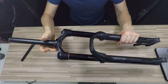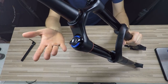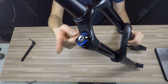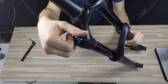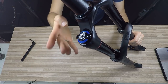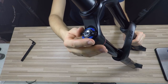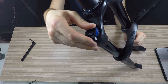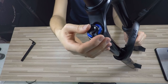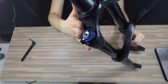Finally, the thing I don't fully understand about the fork is the compression. I understand the feature, but in the description, RockShox say that it is the low speed compression to lock. Now, the first thing is that it doesn't have lockout, so it won't lock. With the maximum compression, it still works pretty well. I would not say this one is broken, because you can feel as you change the compression through the middle to the maximum, you will feel the difference. So it really works, but it doesn't lock the fork.